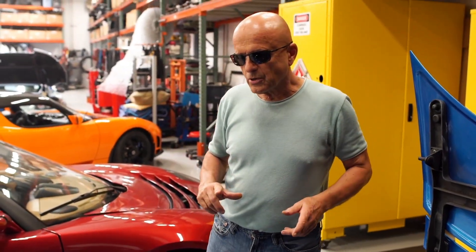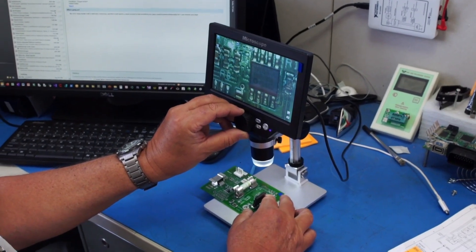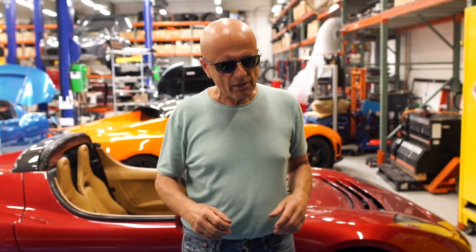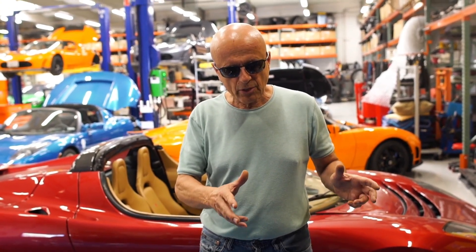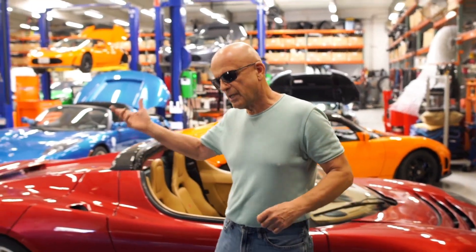The difficult parts are the proprietary Tesla Roadster electronics. This 400-volt HVAC controller, although not proprietary, is at this point out of production. It's made by a German company called Eberspächer. What we're going to do now is show you how we're able to repair something like this and put this car back on the road. So, let's go in the lab.